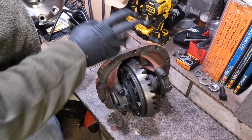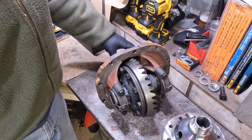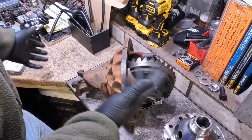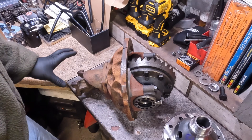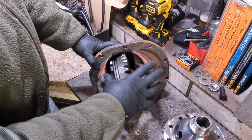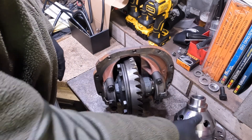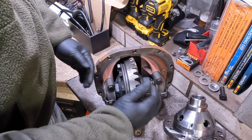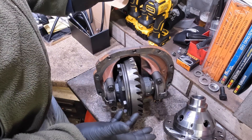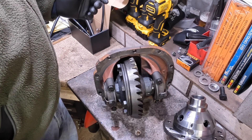It's as simple as it gets. The only hard part is I'm probably going to have to record this in a different segment because I want to get in and replace the pinion seal while I'm here, and it requires a bunch of disassembly and re-torquing. But that aside, the point is we're literally just going to change this diff — take the bearings off, press the bearings onto the new unit, drop it back in, re-center it, set the backlash, and call it good. You can do it right here on the bench with this type of rear end.